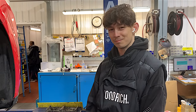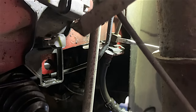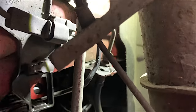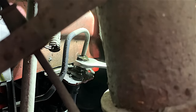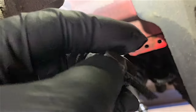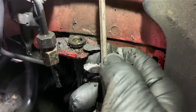My assistant is going to remove the brake hose. The 13mm spanner will undo it — normally they can be a problem and you have to put pliers on the bracket to stop it bending. The brake pipe is starting to drip when undoing it, so I'm going to plug it with a union. I use a female union with a bit of brake fluid, squash the end of the brake pipe in the vice, screw it on — no more dripping.